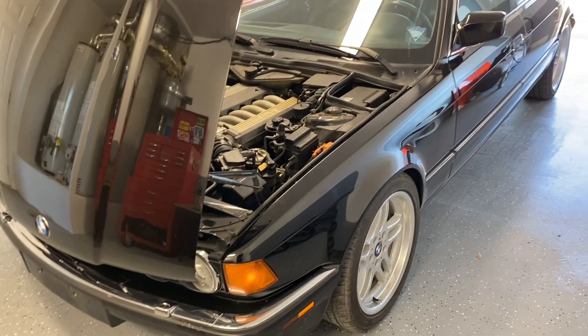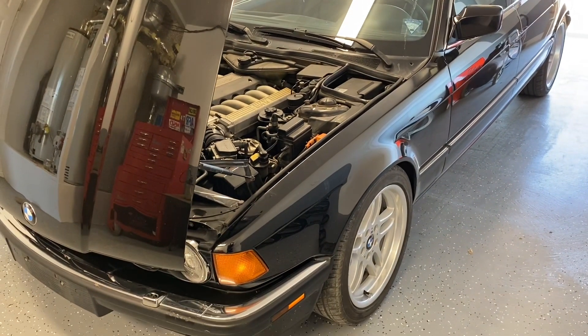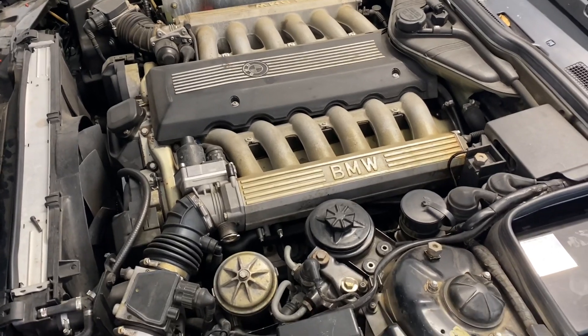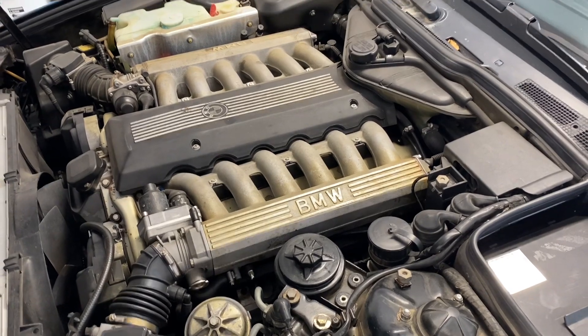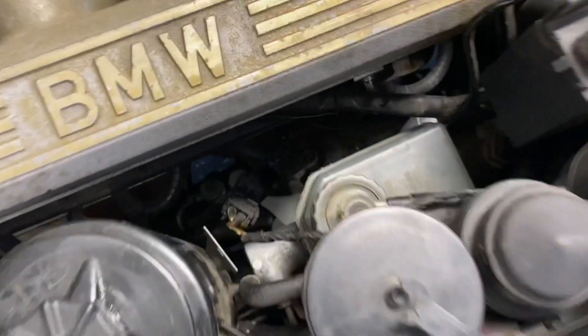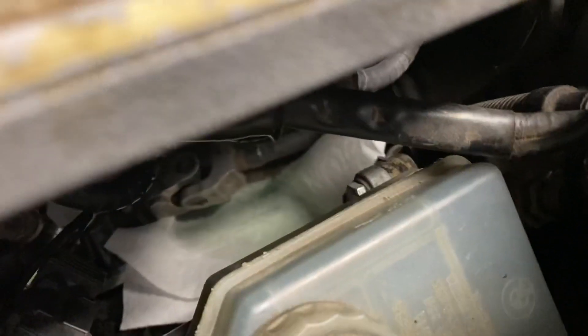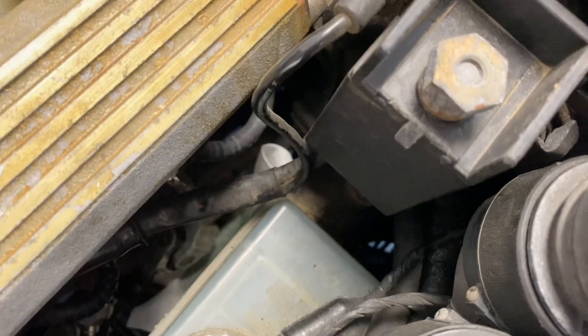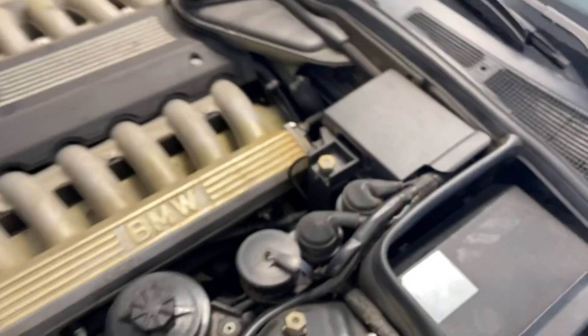We're back in the garage. I just put this car up for sale and pretty much same day it developed a giant hydraulic leak. These cars — the 750s and a lot of E28s, E24s — don't have a vacuum brake booster. They have a hydraulic brake booster, much like a three-quarter ton GM vehicle. This is your master cylinder, and behind it, it looks like a bigger brake booster — that's what the pedal connects to. As you can see from the green CHF-11S soaked paper towel, it's leaking at the seam between the master cylinder and the brake booster on the bottom. I had someone push the brake pedal and confirmed it drips. Since it's not dripping brake fluid, I know it's not the master — it's dripping Pentosin CHF-11S hydraulic fluid. So likely the seal is bad.